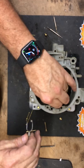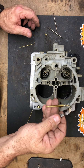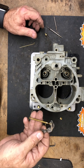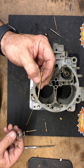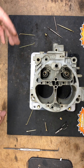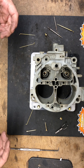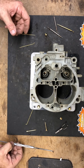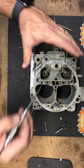Secondary rods are pretty easy to change — that can be done from outside of the carburetor at any time. If you're lean or rich at wide open throttle, you'd change the secondary rods to accommodate that and get within your range. That overall explains several of the primary, idle, and secondary side calibration points for the quadrajet. There's a lot more to it — you also have main air bleeds that mix fuel, and on most quadrajets there is an air bleed on each side.